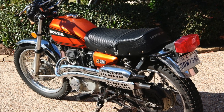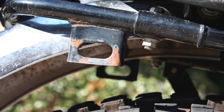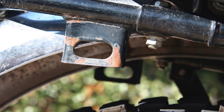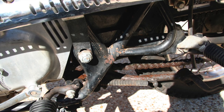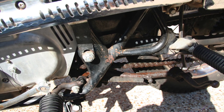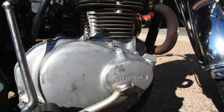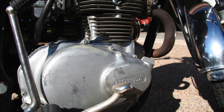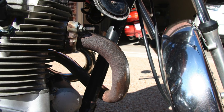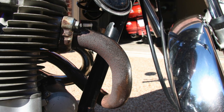At a distance the bike looks like it's in pretty good shape, but when you get up close you can see there's rust on the frame. There are a lot of scratches in the frame, and my objective is to bring this bike back to as close to showroom ready as I can get it. The chain is trashed, there's tons of rust on the center stand, other parts of the frame have some pitting, the engine cases are scarred up, and those exhaust pipes are really badly pitted. The chrome is completely gone, so I knew I was going to have to either re-chrome these or source new ones.